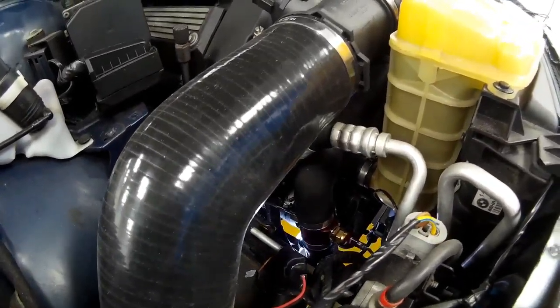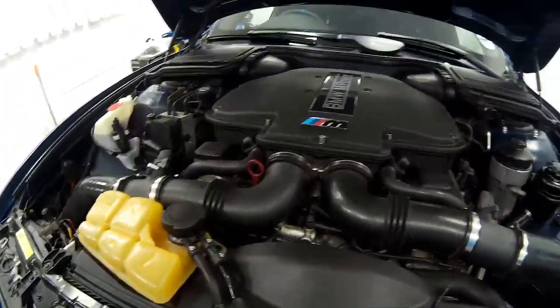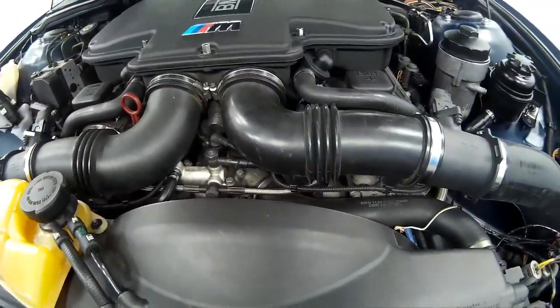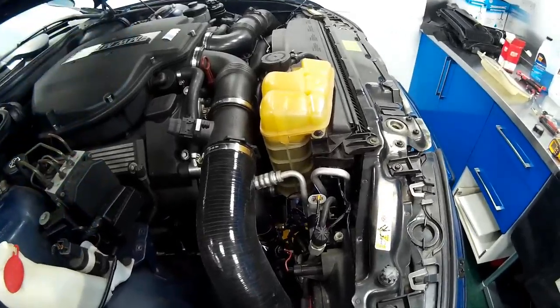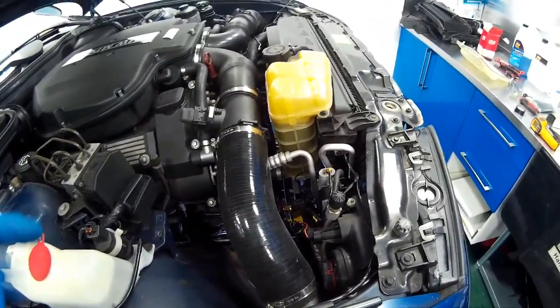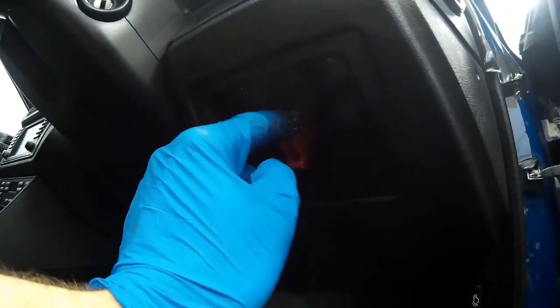We have zero leaks from anywhere — the coolant system and the oil system. Once you've done the electrical side and you're happy with everything, you can put an extra safety measure on by fitting a fan switch in the cabin. It's quite easy to do — just tap into the centre wire. Instead of the centre grounding it, you're going to use it via a switch in parallel. If you run it in series it'll only work with the switch and the sensor together; in parallel it'll work either way. I put my switch inside the cabin using an aero-style switch next to the OBD port so it can't get knocked on accidentally.